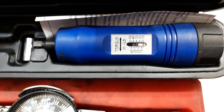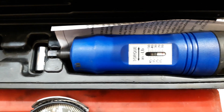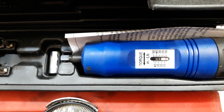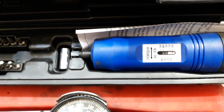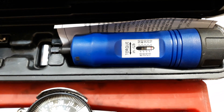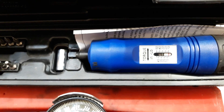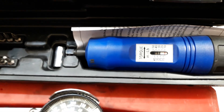These plastic air filter housings require 35 inch-pounds of torque on the bolts that hold the cover on. Everybody does it the old-school way — by feel — thinking they can tell when it's good and tight. Well, I've come to find out that on modern engines, you have to torque it specifically to what the spec calls for.